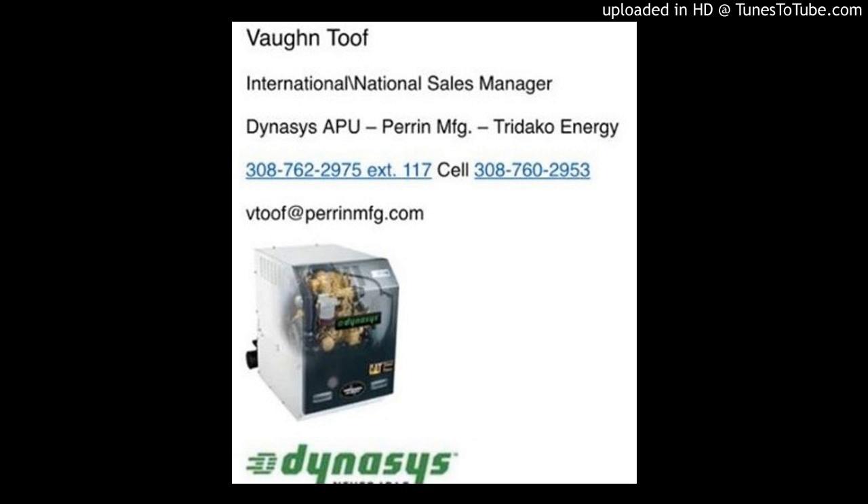What's the benefit to having that APU with the motor going versus the battery packs, like what I have in this Volvo? It's all BTUs — that's how much airflow you're getting to your cab. Them battery packs and solar pack units, you're talking 6,000 to 8,000 BTUs. You're talking 24,000 BTUs on the SL on the cool side and 8,000 on the heat side, but 14,000 on the Gen 2 on both heat and cool. It's a big difference. This is Youngblood — what is the difference in price saving between using the Detroit Optimized Idle and buying one of your units?